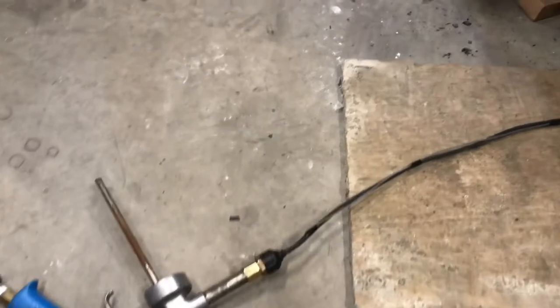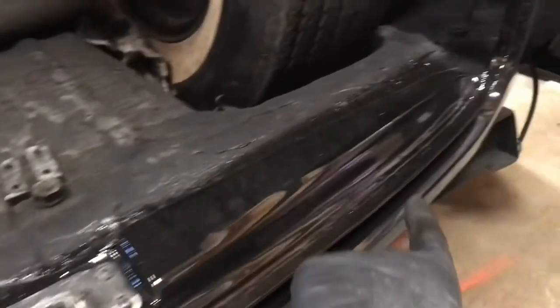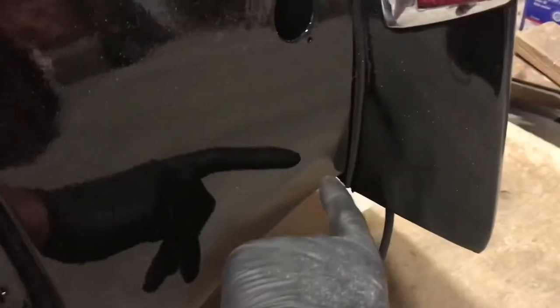Here's the setup. I taped a chunk of wire — some kind of fencing wire — because this tube is quite flexible. I put a chunk of tape there so I know when it's about to come back through the hole. What I'm going to do is push this all the way through to the inside of this cavity, all the way to the end. Then I'll pull the trigger and start slowly pulling it out. When I see that green tape, I'll know when to stop.